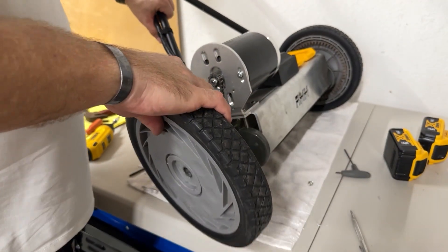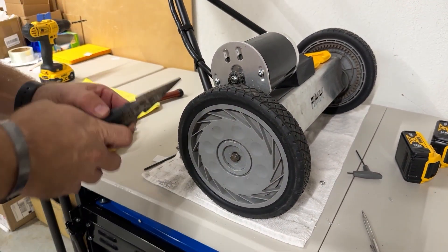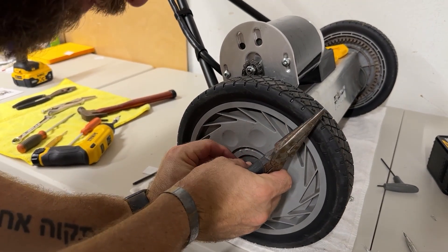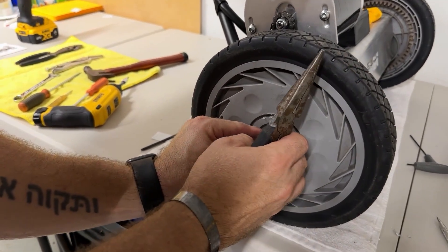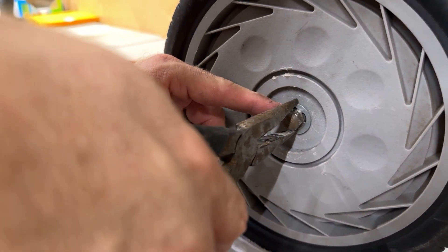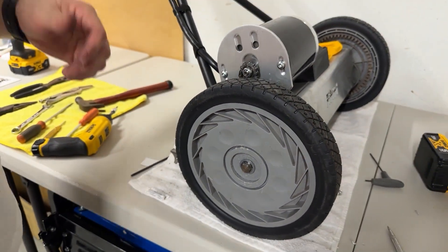Then we're going to secure the chain tensioner. The best way is to come back from the back the same way, grip the nut with your needle nose pliers, and slowly turn the lock nut until it's nice and tight. This can be a little tricky because the chain is in the way — rotate the wrench to change the angle of the open end, going back and forth to get that little bit of play needed. You don't have to go crazy, but tighten it pretty snug — it could come loose with vibration. Double check that your chain tension is still about a quarter inch and make sure the reel spins freely. Then go ahead and put your wheel back on if you're using stock wheels — line it up in the groove in the bolt, take your needle nose pliers, clamp down, and it'll pop in.